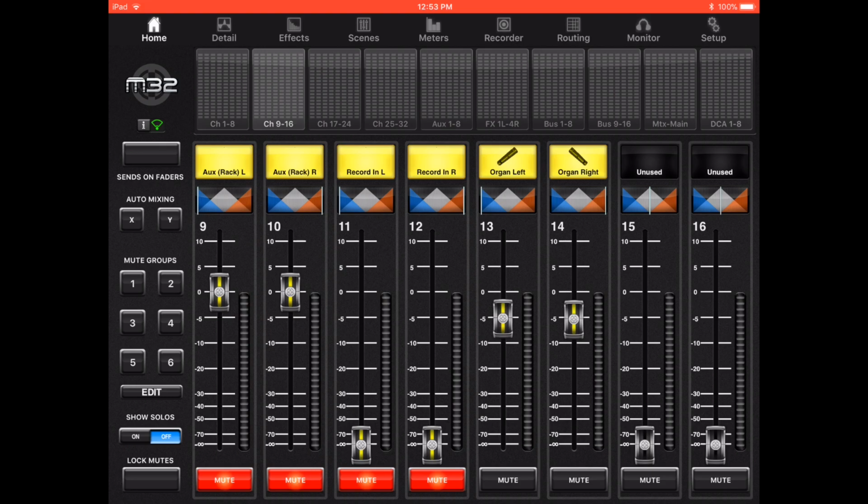The aux rack left and aux rack right. So in the audio rack, you'll see about halfway down there is an insert that says aux input on and off. There's a toggle switch. And then it says aux input volume control. And in the middle is an 1/8 inch stereo jack, the same kind of jack that would be on an old style Walkman or portable CD player, or it's the headphone jack before they got replaced on most phones.